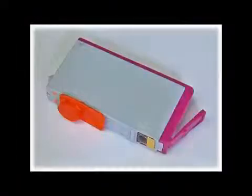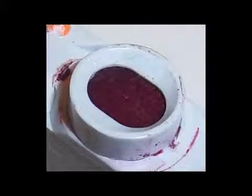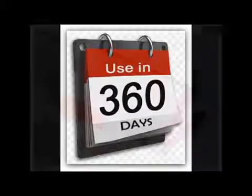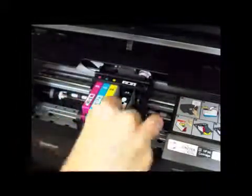As soon as you remove the cartridge from your printer, place the protective cap onto the ink spout provided with your initial refill. This will prevent leaking and will help prevent the internal foam from drying out. The internal foam can harden without the moisture provided by the presence of ink. This is extremely important since the internal foam is susceptible to drying out. Once a cartridge has dried out, it may be too late to refill since the internal foam may have completely hardened. Refilled ink tanks can be used up to 1 year from the refill date, providing the protective cap is firmly installed. Install a new cartridge immediately after removing an expended one.